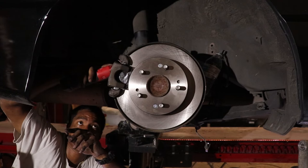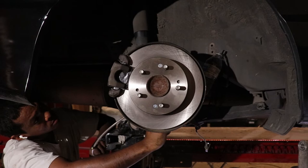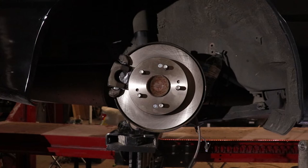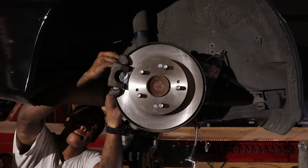I'll be installing stainless steel brake lines on the Civic as well. This increases brake feel by taking away the flexibility from the hoses — rubber will expand under pressure, but the stainless steel braiding on the outside prevents that. So the brake pedal will feel more responsive and a little more stiff. The original lines had over 150,000 miles on them, so it was a good time to upgrade them anyway.